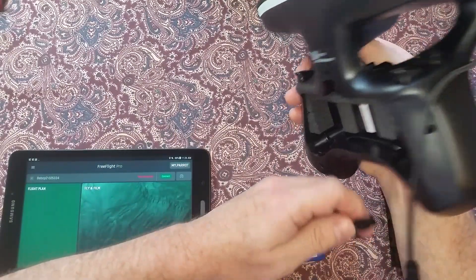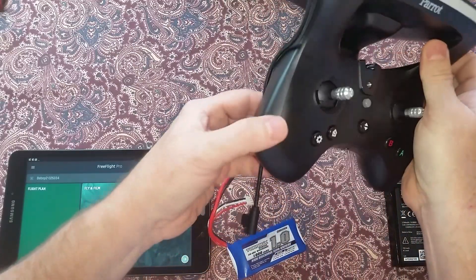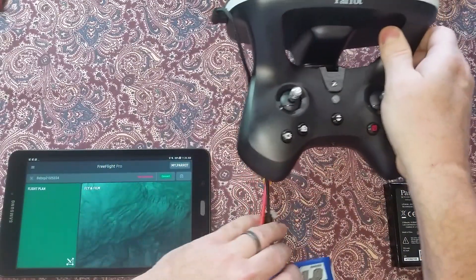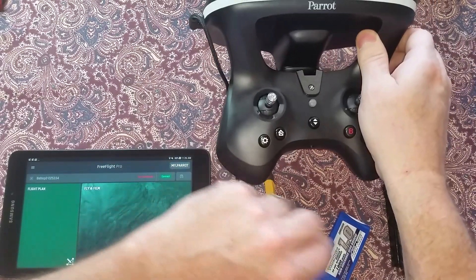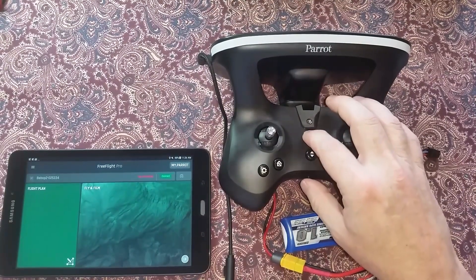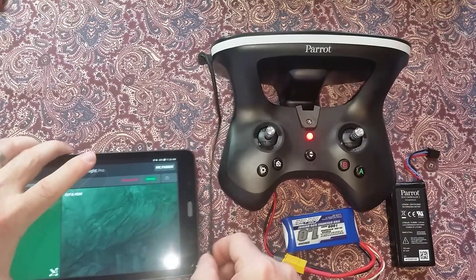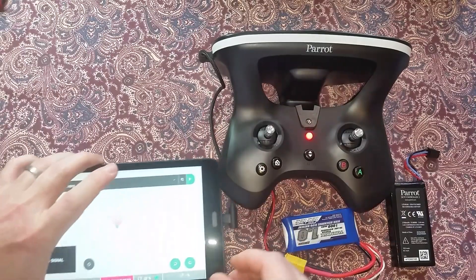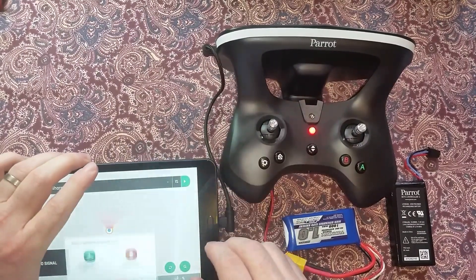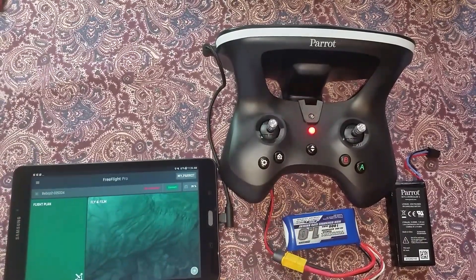Plugging it in, I'm going to show that the telemetry shows up. This battery doesn't have the blue lead — it's only the red and black lead — so the thermistor lead is not in this battery configuration. The stock battery has a blue lead with a thermistor for monitoring charging temperatures. The thermistor lead is not needed with aftermarket batteries.